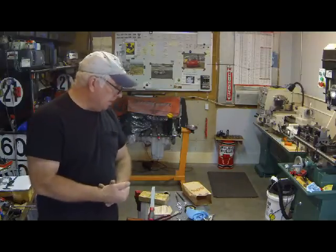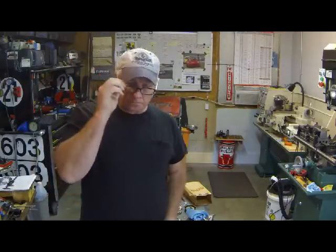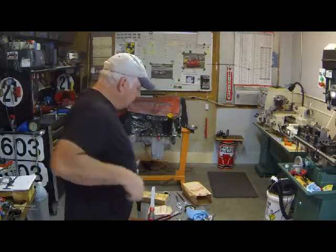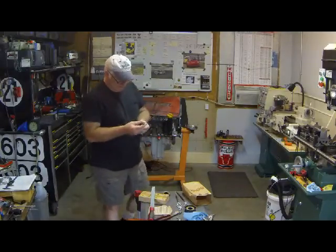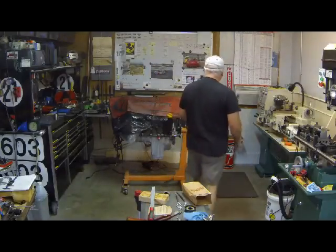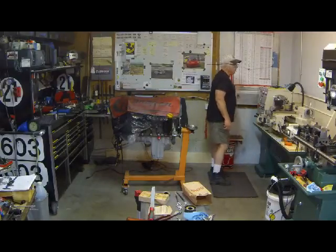So, let me grab my mic, and I don't see it handy right now. It's probably on the surface plate, and I think that's where it is. So hang on one sec. Let me go grab it. Okay, you know, for once it was right where I thought it was, right by the tool chest. So, we'll take a look at the diameter of our rivet, and it is decimal 157, and decimal 157 is just slightly larger than 5/32.